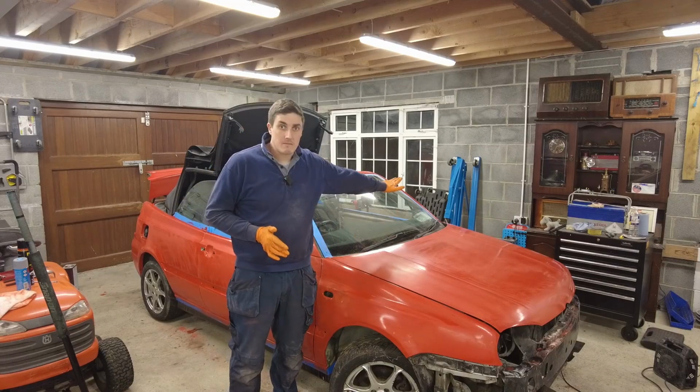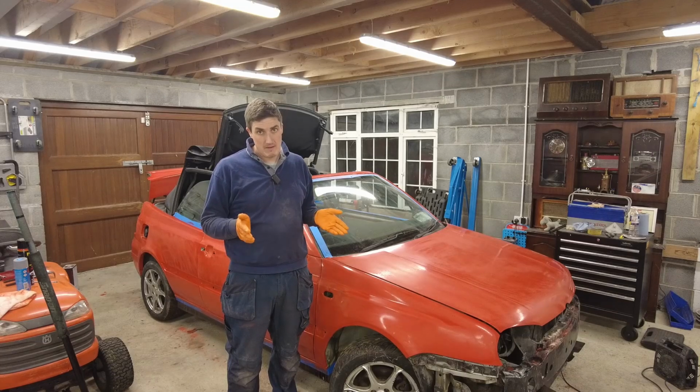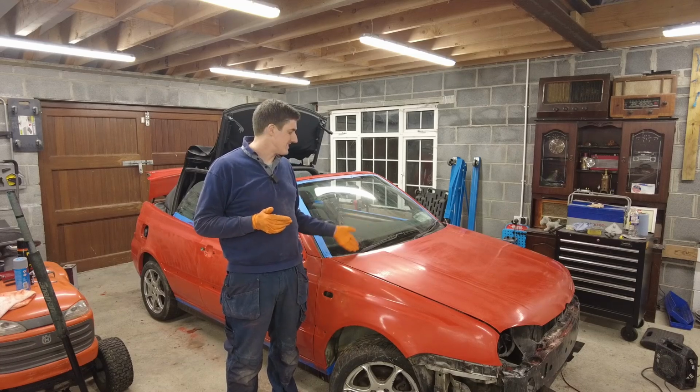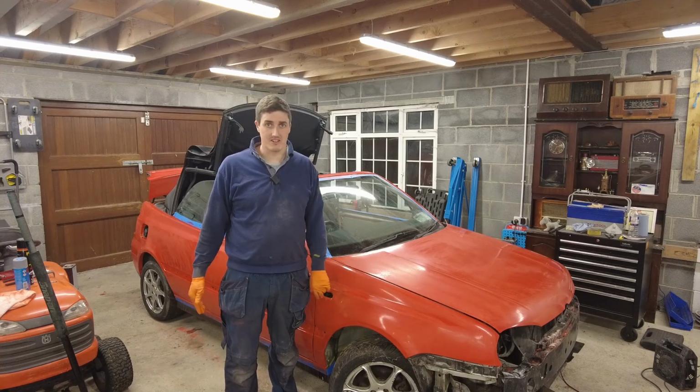But what I did was I flatted it back with 400 grit in this instance. Again, took care of any other little minor imperfections, and we're getting the better of those. But there's still a few little bits and pieces that definitely need covering up. So we'll be hopefully seeing a big change now after the third coat is dry.